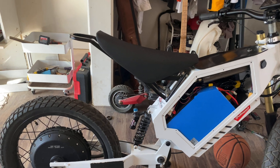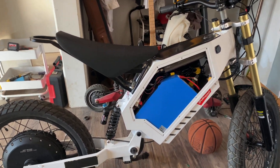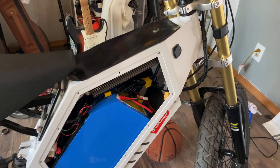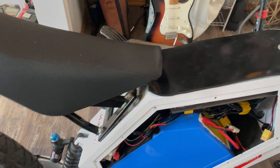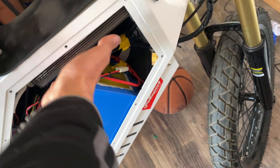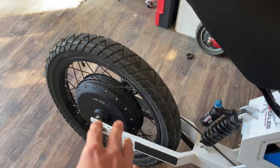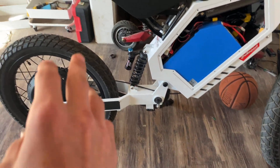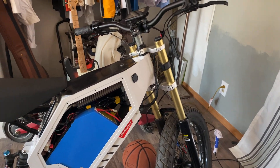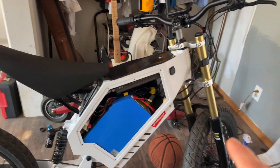That's the final update on this e-bike build — many more videos to come. I have so many plans for videos to do with this bike. Right now I just took off the cover and I'm testing the heat of everything. It stays relatively cool. The only things that are slightly warm are the controller and the battery cables, understandably. The QS273 motor holds up very well with heat, so if you have a very powerful build, you might want to go with this one. I'll see you guys in the next video — probably Tuesday — and I want to show you guys how I program the controller.